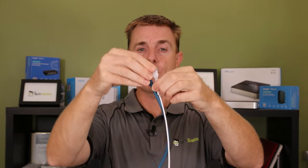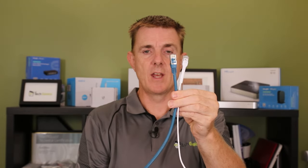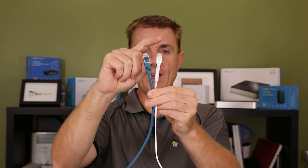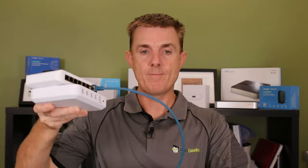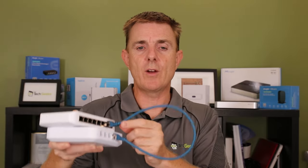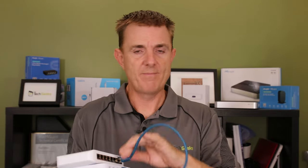Put that up against a Ubiquiti cable — now this one is actually Cat6. On short lengths, the difference between Cat6 and Cat6A isn't really going to make any difference. One of the significant differences is how long the connector is at the top, but more importantly how flexible this one is. With a USW Lite 8 and a Cloud Gateway Ultra in a little rack, if we use a half meter standard cable, we're over-pinching it and risk damaging the cable if we do that many times. We sort of end up having to run with a loop — there are workarounds, but I'm just trying to show you the options.